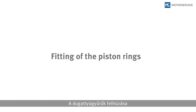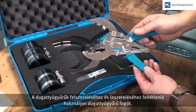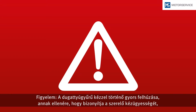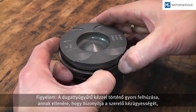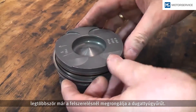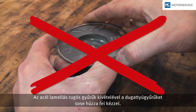Fitting of the piston rings. It is essential that piston ring pliers are used for fitting and removing piston rings. If the piston ring is fitted quickly by hand and without pliers, this may be evidence of the skills of the mechanic, but it will usually result in damage to the piston rings when they are fitted. Except for steel rail oil control rings, never fit the rings manually.